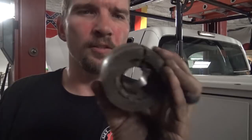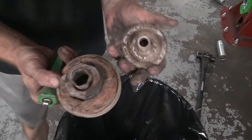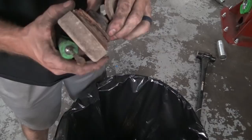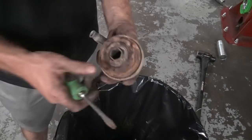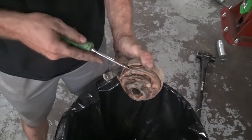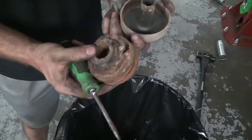This is how you can tell somebody's been in here before - this one was on the top and I don't know where they got this bushing from or what it came off of, but ultimate fail. You should never have to slit your bushing in half to put it where it needs to go. This is how they look - the bottom one goes up and clips in like that. This is what happens to the Ford body mount bushings: they're this kind of foam that just rots and deteriorates.